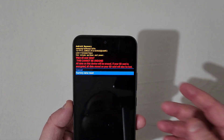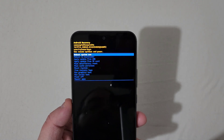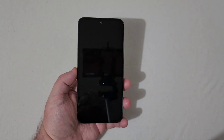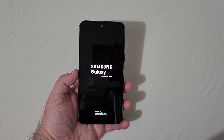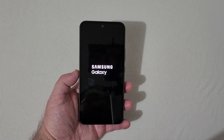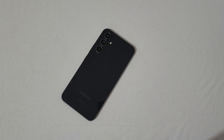Once you do that, at the bottom it will say 'Wipe complete.' Once the wipe is complete, it will take you back to the menu — just push 'Reboot System Now' using the power button. The phone will power off and power back up, starting you back as if you got it from the factory. It will start up as a new device and you'll go through the whole setup process again.